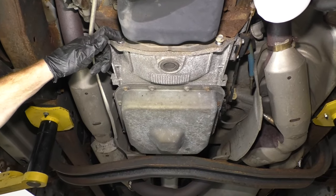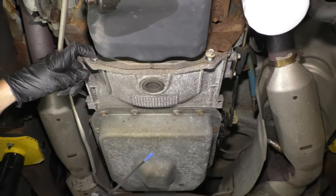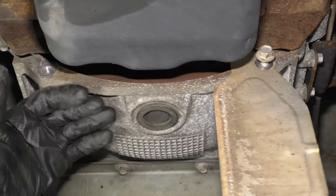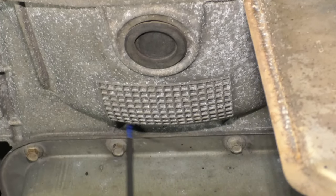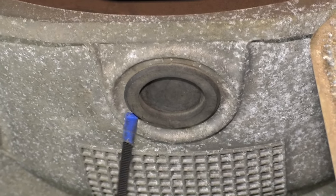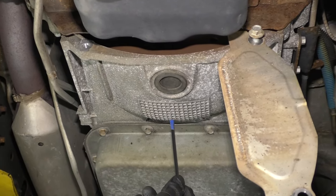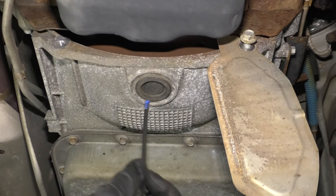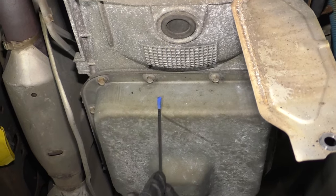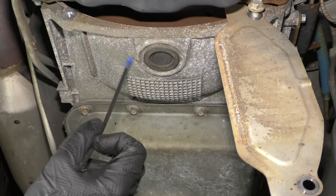To find where your transmission fluid leak is, it's easiest to be underneath the vehicle. The most common places you might find transmission fluid would be around this little boot right here, and if you look behind this plate, you're going to see your transmission bell housing. There's a pump seal located inside up towards the forward end. If it's leaking, the fluid's going to come down along here, sit in here, and make its way out through there. That's happening internally. With that said, if the fluid's leaking down along here and you're driving, it's going to blow back and might make a big mess. Any fluid blowing back might make you think you have a different transmission leak — such as maybe your pan gasket — but the actual issue might be located right in here at the pump seal.